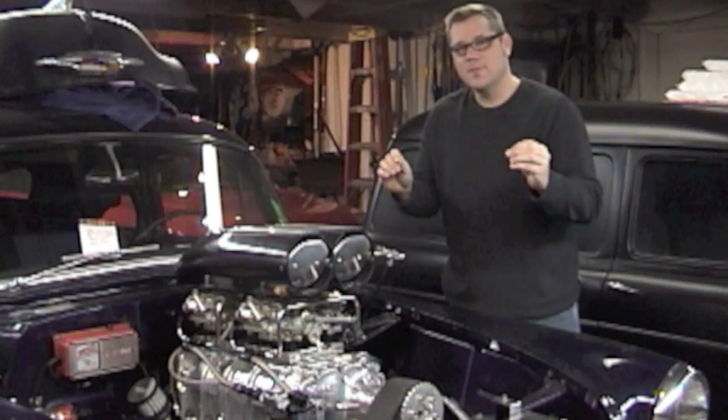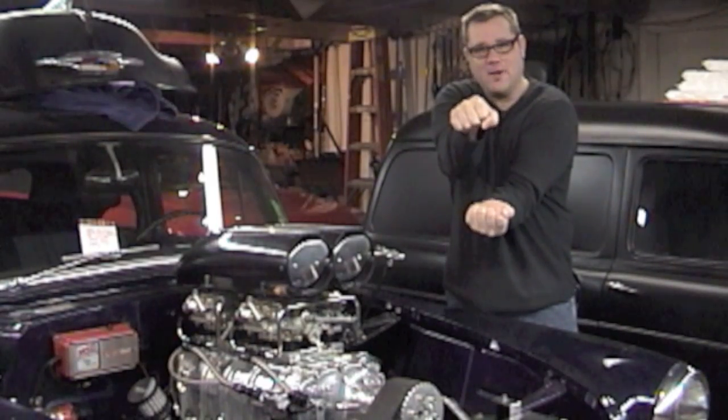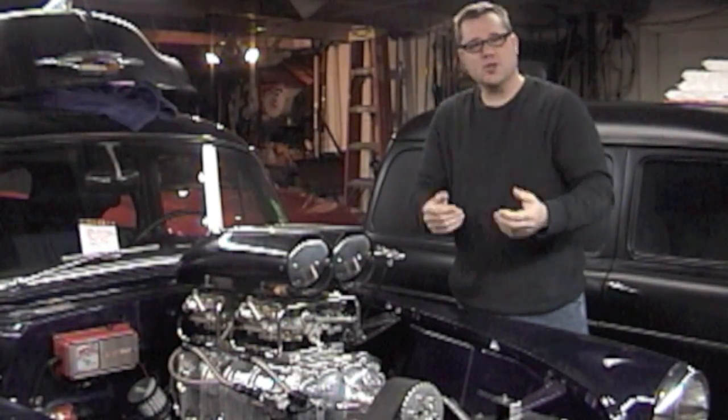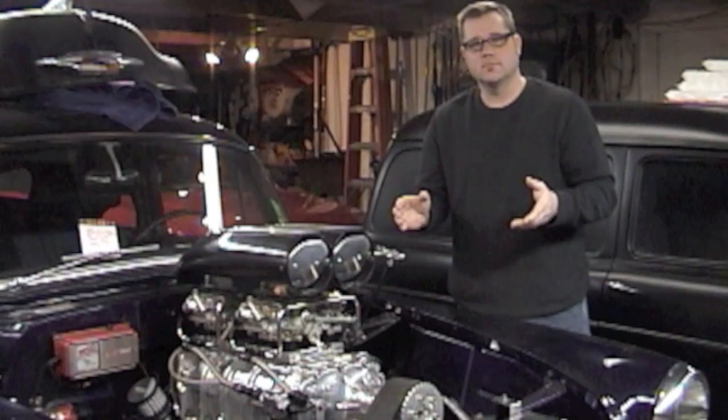She winds really loud but actually that belt is too tight. What happens is as the aluminum grows you're stretching that belt and you're putting all the force on the front of the nose and on the crank — you're fighting each other. So basically you put your belt on, you slide your idler pulley out, and you want about a half inch to one inch of play on the belt. Find the center between the top pulley and the bottom pulley and just push on the belt — you should just be able to push it in about a half inch to one inch. And that's it.